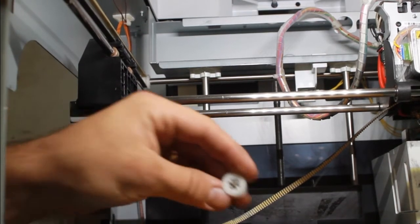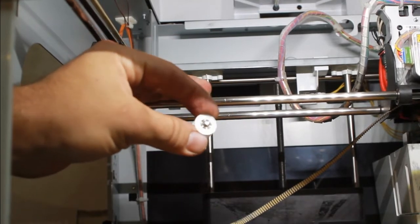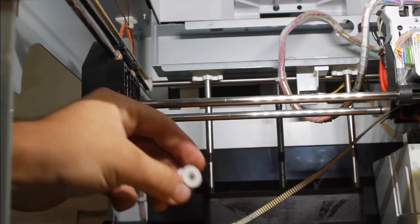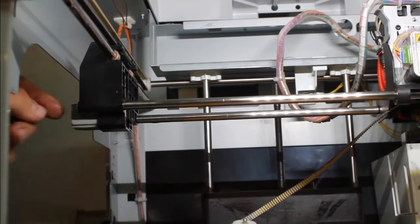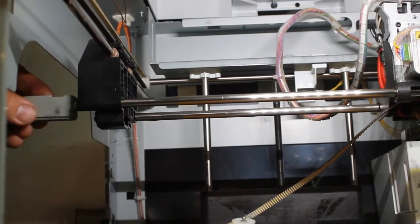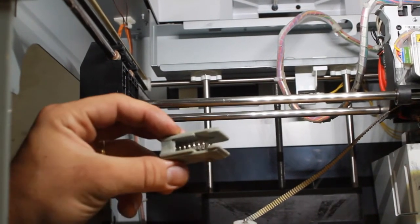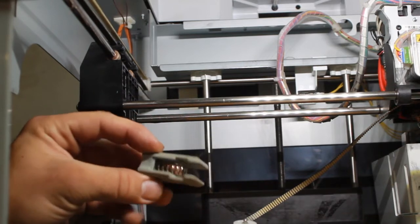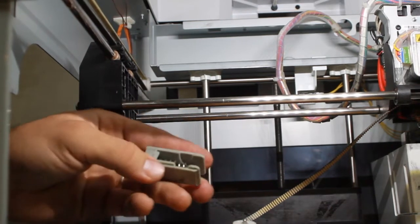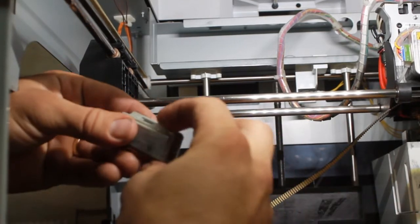Here's what your original one is going to look like. Let me see if I can get that on camera — here's your original pulley when you pull it out. This piece will be black from the factory. Once you take the belt off, this just slides out. This is the 3D printed part that you want. The original is black and what it has is just a slit for the pulley to go in.